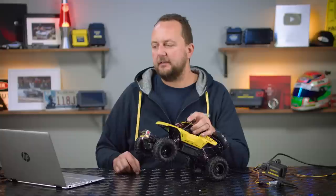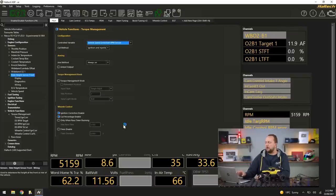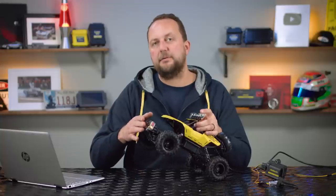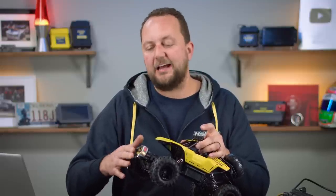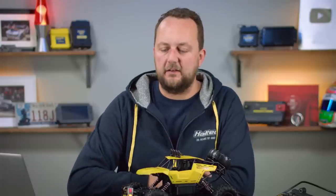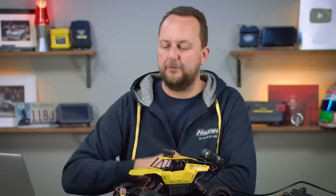About that timer: at the moment, as soon as the car slams back down the cut is gone and it starts accelerating again. If we go down to torque management — the same area where we configure target driveshaft RPM and target engine RPM curves — there's a timer enable option. Setting that to 0.3 of a second means when the car lifts, the cut percentage occurs, the ECU records the highest cut percentage seen, and when the car drops, it holds that highest cut percentage for 0.3 seconds. That gives the car time to accelerate and pick up road speed so it won't have enough power to lift the wheels again when power is fully reintroduced.